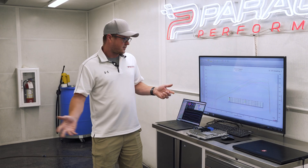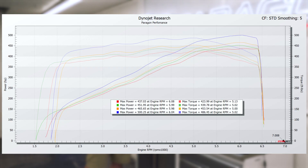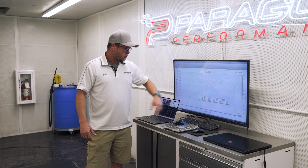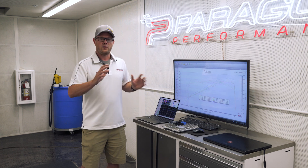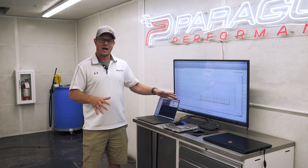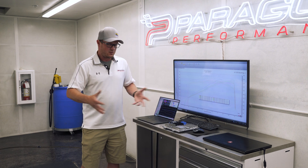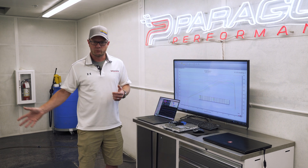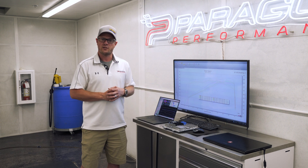The next thing we did was get some 93 in here, test that, and do some more tuning, and we brought it up to 465 horsepower and 453 torque. Again, very good numbers for today in these conditions in our dyno room, and a nice big jump from the stock baseline on 91. We've seen that these cars can put down this kind of power with these types of mods and no tuning, but it depends on weather conditions, dyno room conditions, and everything else. For today, 465 was a very good number in my opinion.